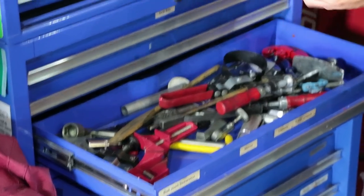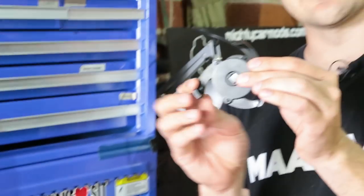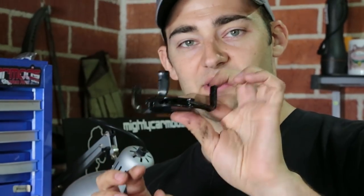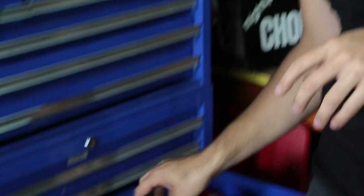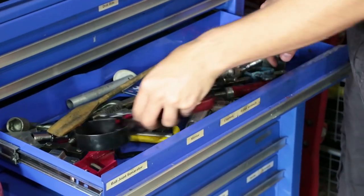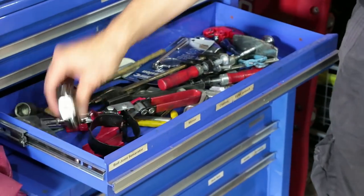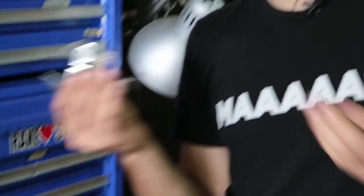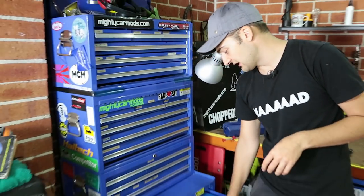This stuff is more specific to cars. This is my favourite kind of oil filter removal tool — as you undo it, it grabs the filter tighter, and I like that it's small, which is great for getting into cramped engine bays. You might find you need a variety of these as you come across different cars. These tools are relatively inexpensive and will make life a lot easier. There are also things like clamps, windscreen removal tools, and pullers — you may not use them often, but if you find yourself needing one, I'd highly recommend getting it.